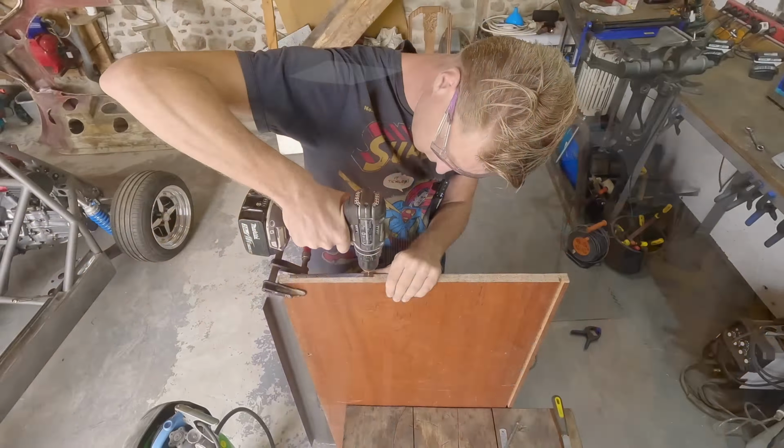We need to make a little vent for here that'll direct the foot blower into the passenger side footwell, otherwise it will just blow into the middle of the centre tunnel. But we're not going to make it yet because we want to make it out of 0.5mm thick steel because it doesn't really need to be structural. It will stiffen the centre tunnel, but other than that, it's not really doing a lot. But we've just bought a big sheet of 0.5mm steel. And when you buy a big sheet, it's always better to do the big stuff first and then you end up with loads of scraps after. And you can use those smaller bits to make things like this. So we're not going to make it yet. We're going to wait and do it later.